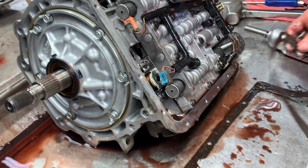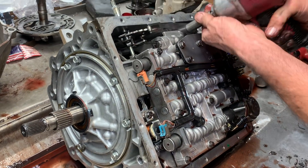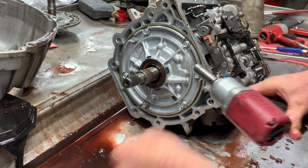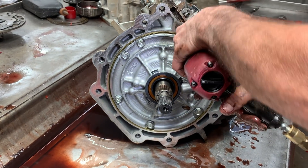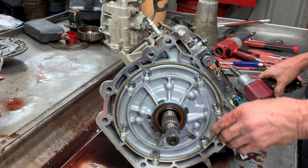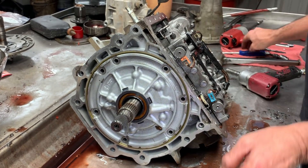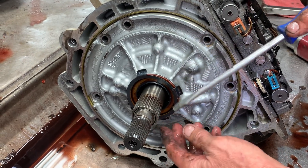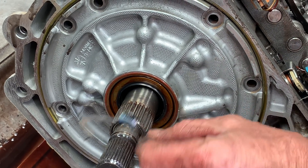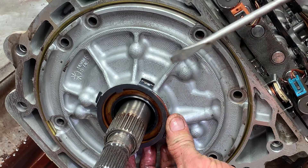That gasket's about as old as old can be — probably was never serviced in a long time. I don't even want to put my parts in that, it's so bad. Now, you notice it does have a seal retainer. Any time we put the front seal in, we glue the seal and the retainer. Did you notice how easy that comes off? So it's kind of a good idea, kind of a bad idea — but if you glue them with that yellow glue we use, it's a good idea.